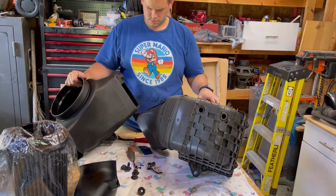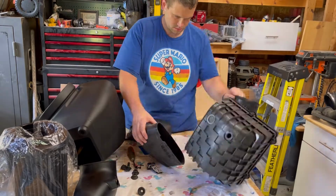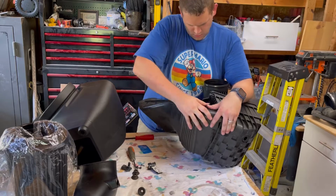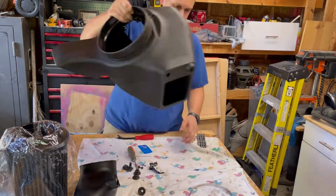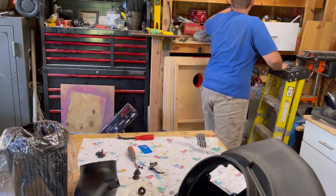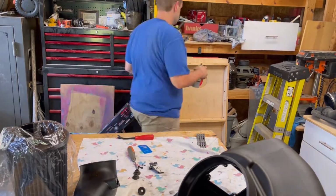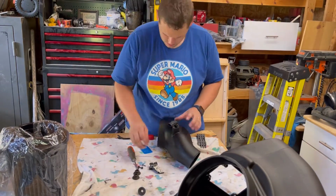So there's a hole at the bottom of the Banks air intake box, and I'm looking to see if there's anything I need to remove from the stock one to cover that hole. And after inspection and looking at the install instructions, it looks like it's just another port for the cold air to pull air from. So now I'm getting my mass airflow sensor, taking it outside, gonna clean it off with some mass airflow cleaner and install it into the drop down tube for the turbo.